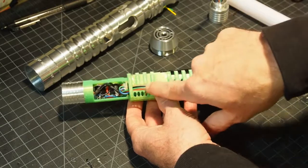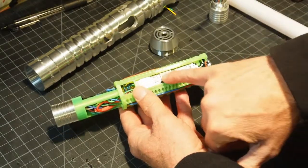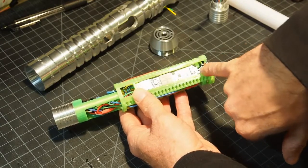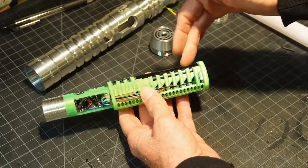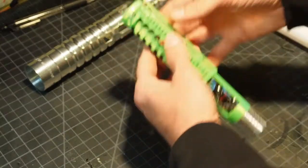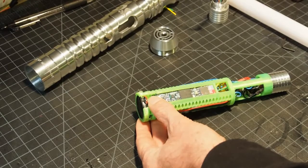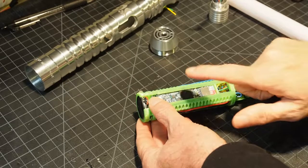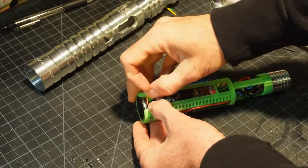And that sits on top of a custom circuit board that was cut on the CNC. Beneath this is the microcontroller, the Grinning Lizard shield that I make and have fabricated and sent. This is of course the battery and the back speaker. So the one thing you may want to do is reprogram it. That'll take the Arduino IDE as the easiest way to do it, and opening up a serial connection to the TC35, which is pretty straightforward. It's installing some stuff.